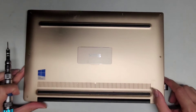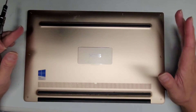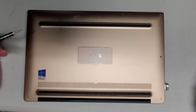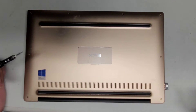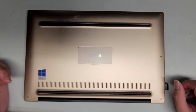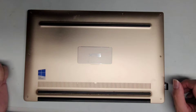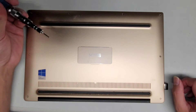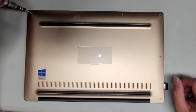I'm trying something a little bit different. I actually lowered my camera a lot and then just zoomed out to do more of the wide angle view. I'm going to open up and disassemble this Dell XPS 13 9360. The first thing we're going to do is remove all the screws from the bottom using a T5 or Torx 5 screwdriver.